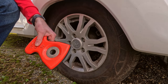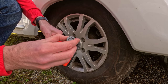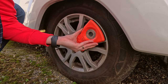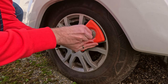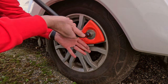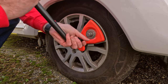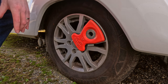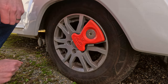When you come to attaching the device, you'll get the bolt — it's got a special locking wheel nut cap at the end, so it's unique to your caravan. Then it's a case of just lining it up, spinning it around till it goes in. This is the nut that comes with the actual kit — it'll be unique to your caravan. Use this to get it started and start locking it into place, then move on to screwing it on and tightening it up. You don't want to go too mad because you want to be able to get it off again. Then it's just a case of releasing the locking wheel nut, putting it in, turning the key, and you're good to go — that's it in place.